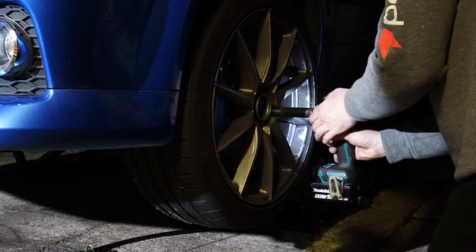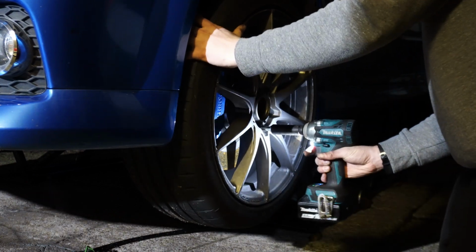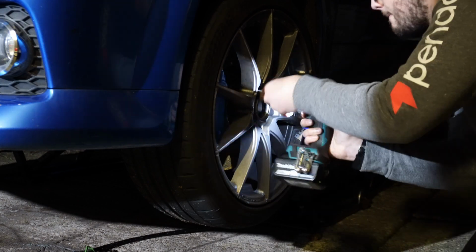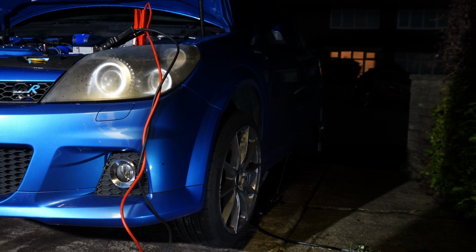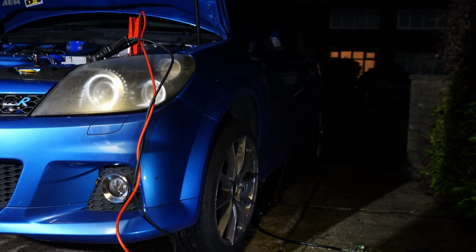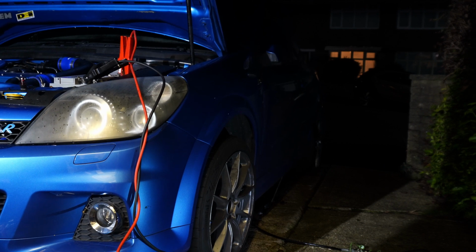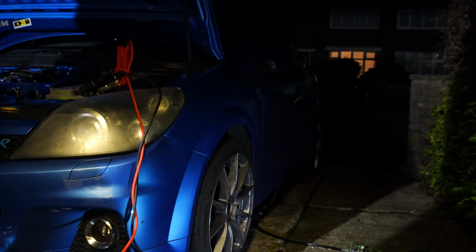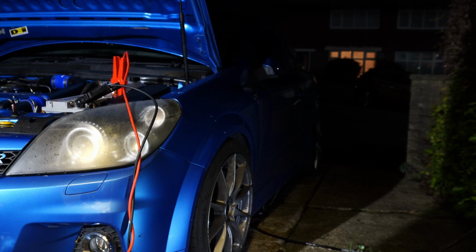I highly recommend, if you have normal wheels that don't use internal drive tuner bolts, just get an Imperial Performance kit, which is much higher quality in my opinion, having tried both, but these M-Tech ones were the only ones that would fit with my setup. I'm just test fitting them hand tight here to make sure that everything clears, because I'm a bit concerned about having what is essentially 20mm more poke than stock wheels, along with the front being so low on the Eibach Sportline lowering springs.